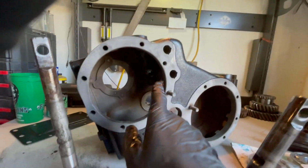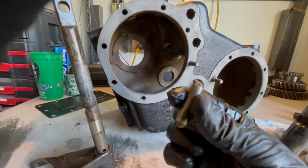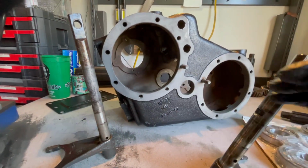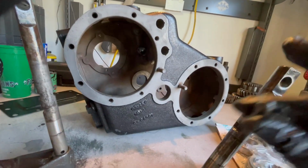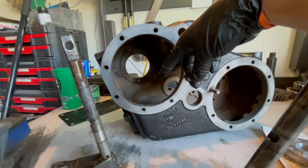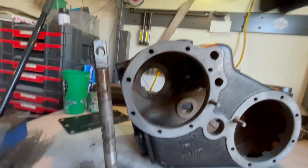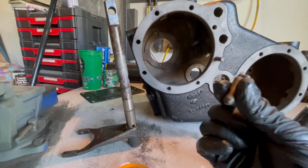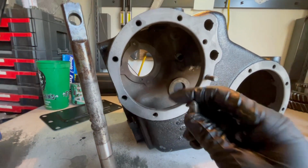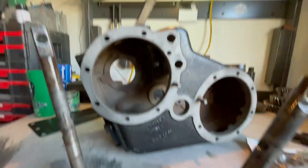lever in place. So you have the bottom one in there, and then you have this little guy that sits between them. So when the bottom one is out, the top one can't also go out. The top one stays locked back because this little guy is locking it in place. But once you pull this one back, it unlocks this and allows you to pull this one forward. So it's basically a safety mechanism, and this little guy is important. So you have a ball bearing on the bottom, this little guy, and then you have another bearing and spring on the very top.